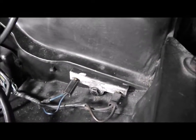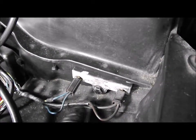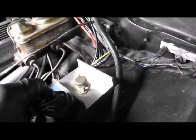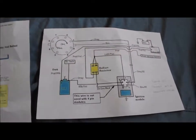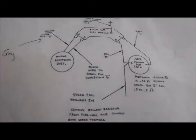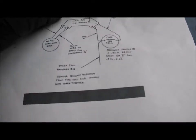You can see there's been some splicing here with the wiring going in for the ballast resistor, so I'm going to check I've got all this wired up correctly. I've got some diagrams printed off over here on the workbench to look at. Failing any of this working out, I've got some guidance from the A-body forum about fitting one of these GM HEI ignition modules - looks like a fairly easy thing to wire up.